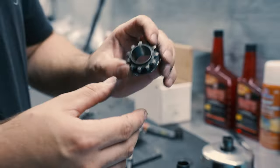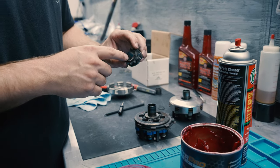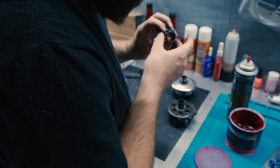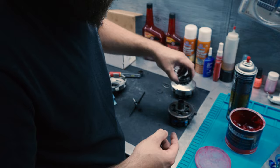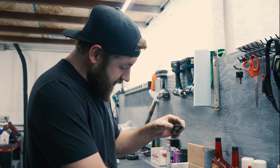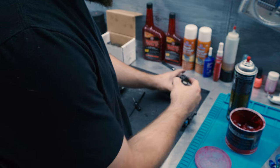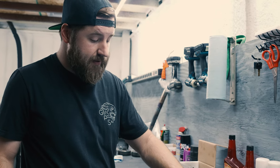Whenever I'm putting the gear back on, I always put a little bit of red grease on it as well. The 11 tooth doesn't use a bushing or a bearing — it's just metal on metal contact. Same with some of the nines and tens out there. So always just get a little bit of red grease — that's more than enough. Try to spread it kind of even, put it on upside down to work it around a little bit. If there's any excess with a huge clump somewhere, wipe it off, put it back on and spin it back around. You don't need globs of red grease everywhere — just enough that you know it's there. Then put your clutch all back together and you should be good to go. If you ever hear any weird noises, you probably just need to service your clutch. It's basic maintenance, very easy, but you have to do it. And if you don't do it and you complain about it, it's your own fault.